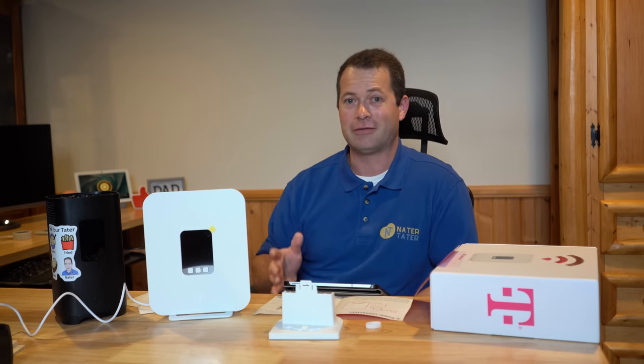I then went straight up to my third floor — a little HVAC-controlled nook that's level with the attic space. It's really an ideal situation for these gateways since it's almost as good as putting an antenna up there. The signal got much better — four out of five bars on the gateway. On 5G it showed N41 again with signal-to-noise improving toward the 20 mark. First speed test there got 188 Mbps download and 26 Mbps upload.